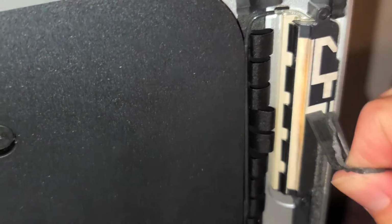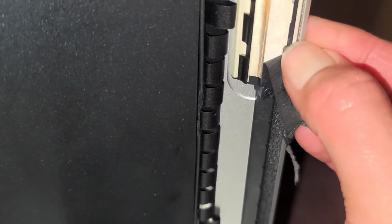Try and get off as much of it as you can. Alright. Also, there's other adhesives, but I found that if you don't order the right kind, the adhesive tends to not stick very well. There's some other kinds of adhesives and you risk dropping your whole screen. So you want to make sure that you get a good adhesive. Don't just put some regular double stick tape. It needs to be a good quality double stick tape, okay?